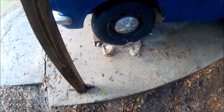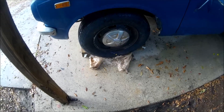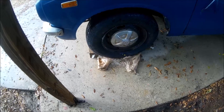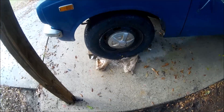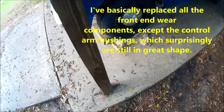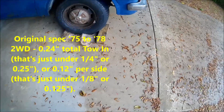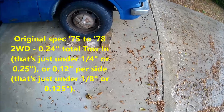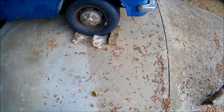These are 70s instead of 75 aspect ratio, which gives a little more tread patch. Tire shops will want you to get an alignment with new tires, but you don't have to if the vehicle tracks straight and doesn't pull. I got new front end parts and new tires, so I'm rechecking with the string method. Previously I adjusted to one sixteenth per side, one eighth total. The spec up until '83 is 0.24 of an inch total, about an eighth per side.